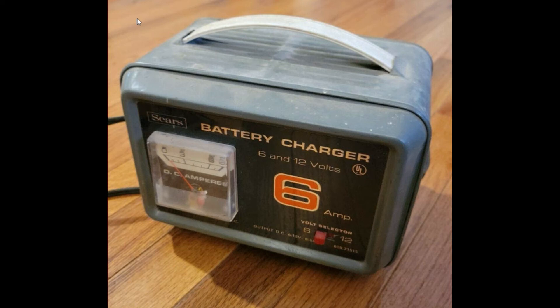At the end of three days, I put the Schumacher automatic one on, and now, with the voltage up to around 10.5 to 11 volts, it was happy and it would start to charge the battery. It said 53%, so I left that for another three days — so now we're six days in — and at the end of the sixth day, the auto charger said it was fully charged.